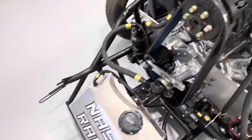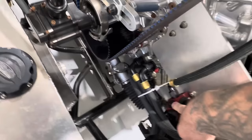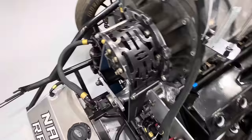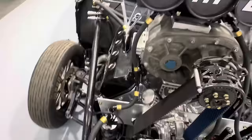I'm going to pull this fuel cell out — even though Matt already worked on this, this was an afterthought and it's my fault — and have him weld a bung back here somewhere. We'll probably have him weld two standoffs to bolt a small external primer pump to it, plumb that primer pump into this port of the regulator, and it'll backfill and prime the whole system. We'll put it on an automated output based on fuel pressure — when you turn the switch on, the fuel pump will run until fuel pressure is up, at zero RPM only. We'll also need a check valve on that line so it doesn't bypass back into the fuel cell.